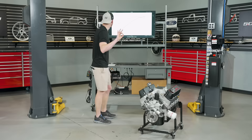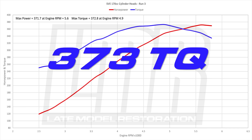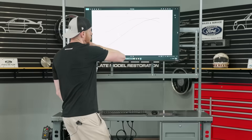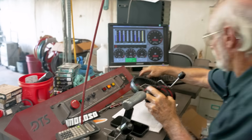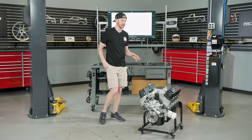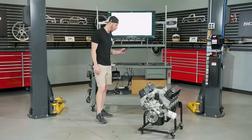Run three was our best run for the 306 cubic inch engine: 371.7 horsepower at 5,600 RPM and 372.8 pound-feet of torque at 4,900 RPM. Real nice, pretty curve — great for a street-driven engine and it definitely met our expectations. Ted had told us we could probably expect 1.1 to 1.2 horsepower per cubic inch with this setup. Take 371.7 divided by 306 cubic inches — we get 1.21 horsepower per cube. If that doesn't tell you that Ted knows what he's doing, I don't know what does.